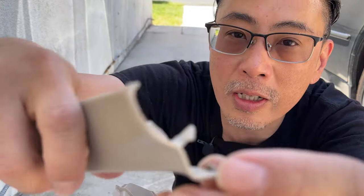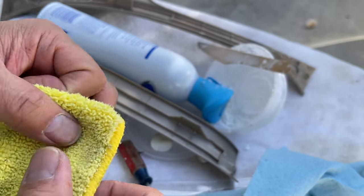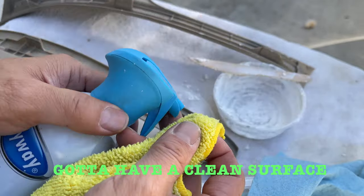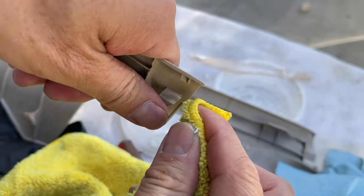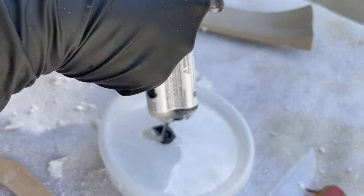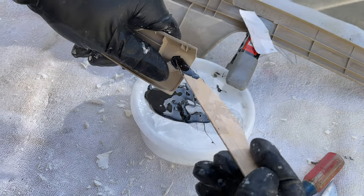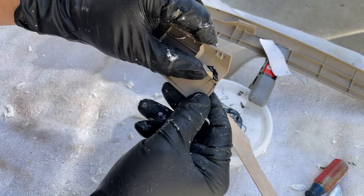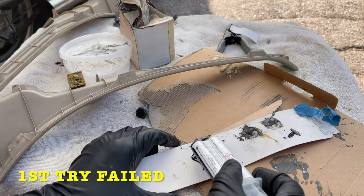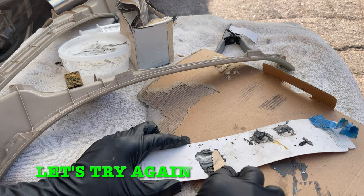Here's the problem — that tab is bending and breaking. Let's start with the spray, put it on a corner. Good grease remover, you can get in that little crack. Now for the plastic bonder, put some down there, mix it up, jam a bunch of this in there and close it back up. The whole thing just came out — that could have been my problem, I didn't mix it good.